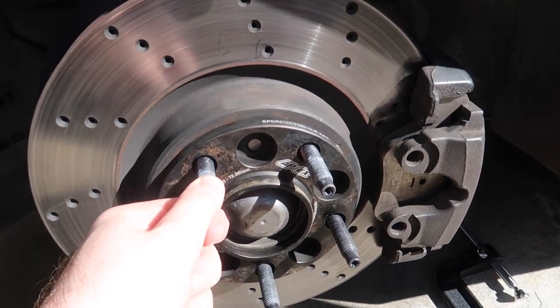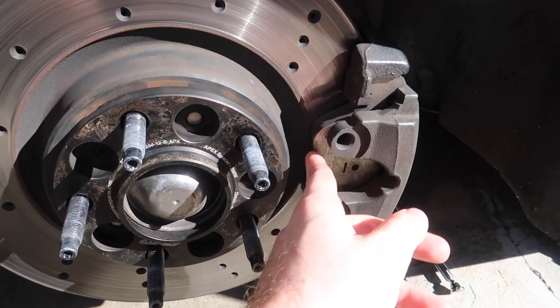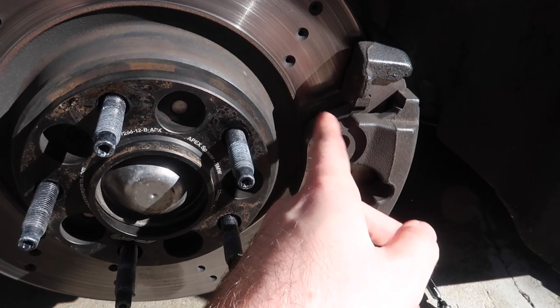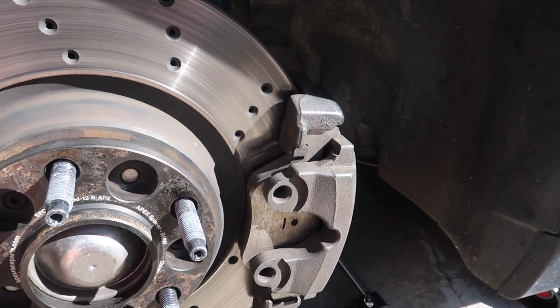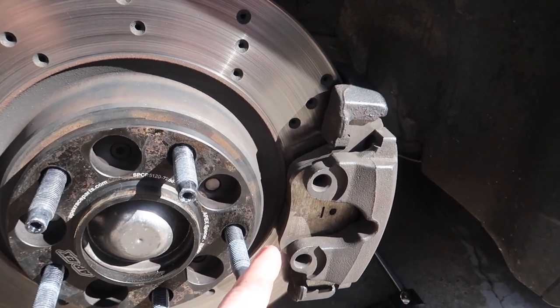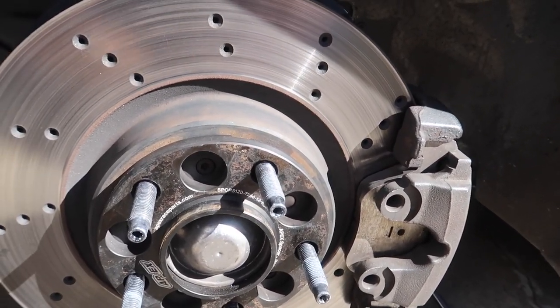Don't forget to compress your pistons — I just made that mistake and now I'm doing it over again. I just finished up the first side and I'm gonna do the right side; luckily it's only the front. You can see right here it spins very easy — before it had a lot of resistance. These pads don't have anything that makes them stick to the piston; usually pads have little prongs that keep them attached, but these don't, so they make a lot of noise when you come off them.